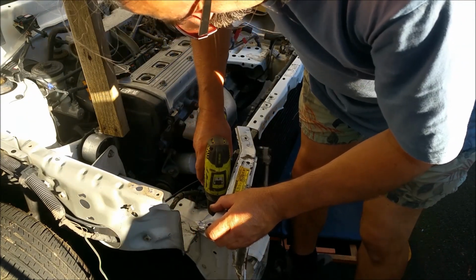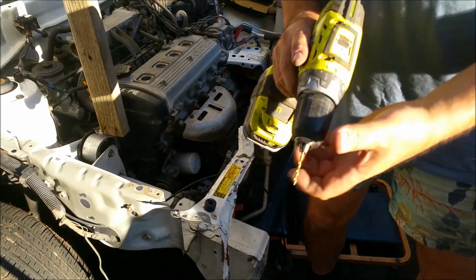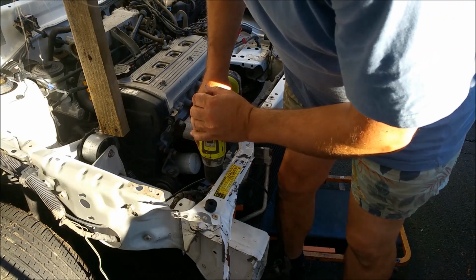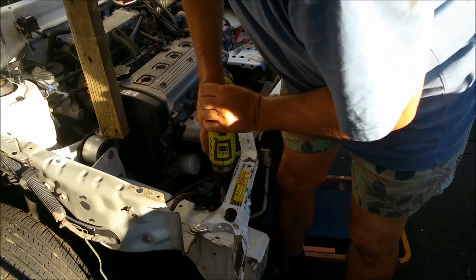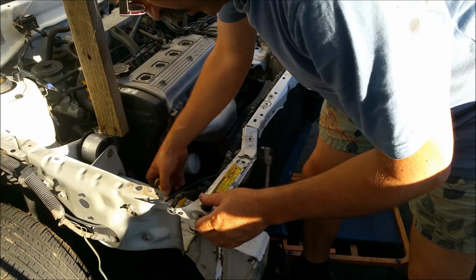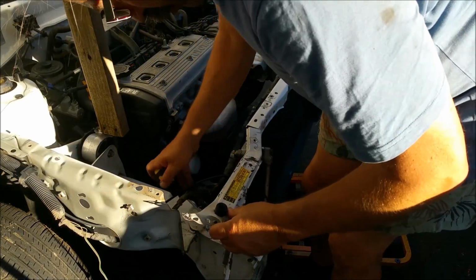And I'm just going to start there. And I'm only just drilling through the first skin just to give the drill somewhere to hang on to. And there's another one here. And then we take him out. Put this great big sucker in. Hang on. And just do it on slow speed. And just chip away at the top of the skin. Just a little bit. Don't go too deep into it, and then it'll just chip off. It's just easier than mucking around with it the other way. And there's nothing left to grind off. So that'll come off. Might have to give it a bit more. And that's coming off now. It's not like we're keeping any of this stuff.